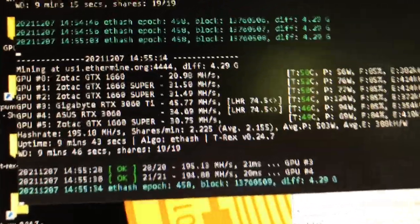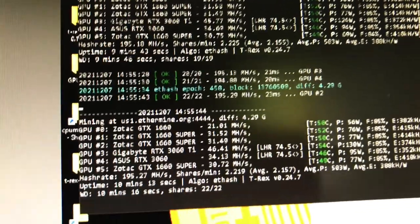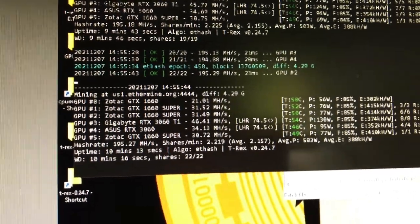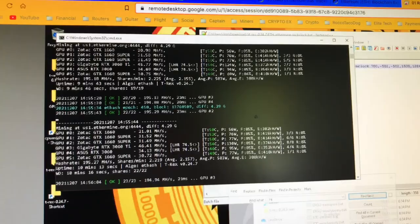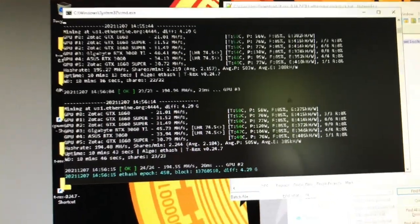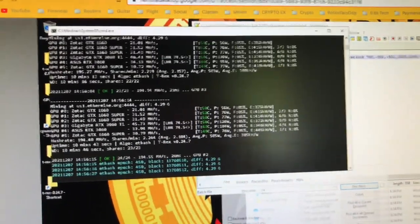I hope this helps. I'm glad I went through and played around with this more. The only one I want to tweak a little more is the regular 1660 - originally at 24.4 megahash and now at 21, so I might nudge up the lock core clock a bit. Other than that, this is a great thing to look into if you want to save power and be more efficient. Check out T-Rex Miner's lock core clock setting. I'm no expert - I'm learning as I go - but I came across this today and tried it because I want to save on power usage and cut down on heat. The less watts I'm using, the less heat I'm generating, and maybe it'll make the cards last longer. Thanks for watching!